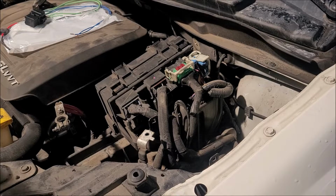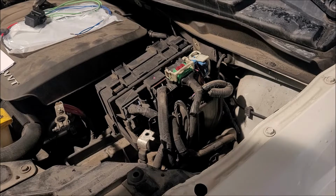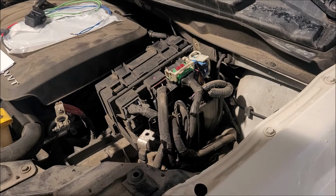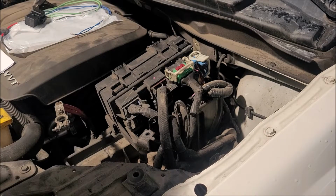So we got some wires on here. I'm going to put everything in the description, and I'm going to see if I can find the link to where I got the recall paperwork and put that in the description as well. So we have a brown wire we have to get under here, which is going to go to relay coil 85. A pink with a light green trace is going to go to relay coil 86. And then we got the dark blue and orange, which is going to go to 87, which actually is the load to the fuel pump, and then our red fused eyelet. Obviously the brown is ground, and the pink with the light green trace is going to be our trigger.